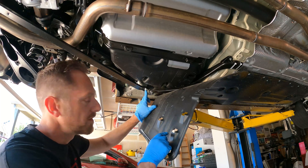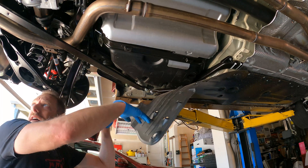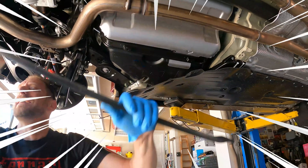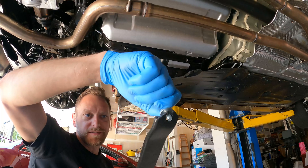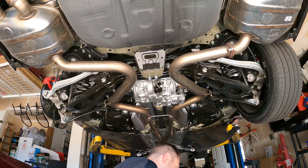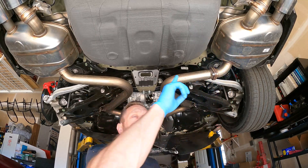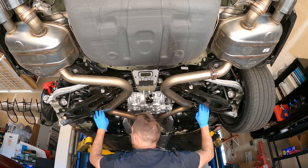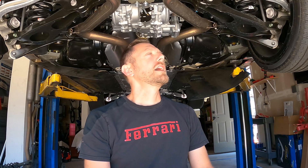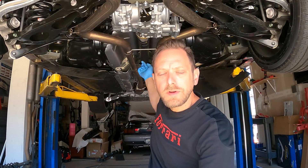With the shield down, you can see that this bolt is going to come off. The one in the back has a slot on it, so you only need to completely remove this one — I've already pre-loosened the one back there. It is slotted but it didn't want to come out all the way. With those cross braces down, you can see that the exhaust system does this weird swoopy thing. We've got one connection here for one muffler, one rubber hanger on this muffler, one on that muffler, one on either side here, and then one on either side farther up.